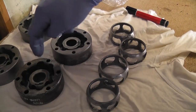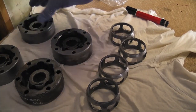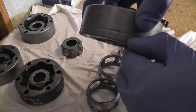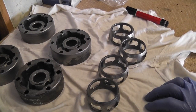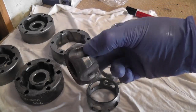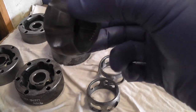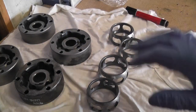I've measured and inspected all of these again to make sure the wear direction is the opposite of the way they used to run. There's one groove there that gives me a little question, but honestly I think it'll be fine — they're mirror image on either side so we'll assume they're alright that way. I've also looked at the inner races. This one is probably the worst of them with a little bit of pitting on some wearing faces, but if it's operating in the opposite direction that should be absolutely fine.